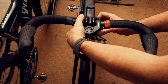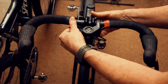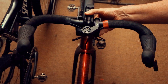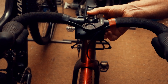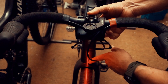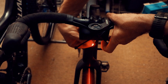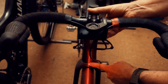The back part goes against the stem to align everything together. You just put it underneath like that, push it in, everything's aligned, then turn the unit on. It projects the laser beam down the front of the wheel to indicate if the bars are straight or not. The laser beam can also be calibrated — you adjust the lens so the beam meets the center of the bike and projects across the tire.